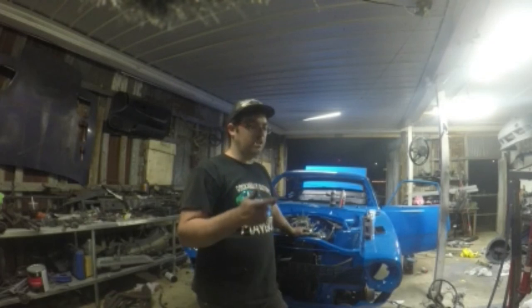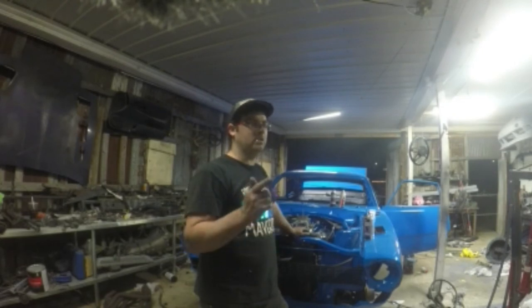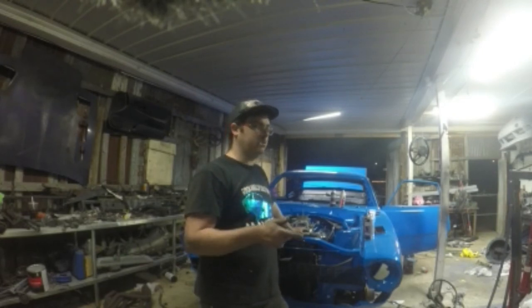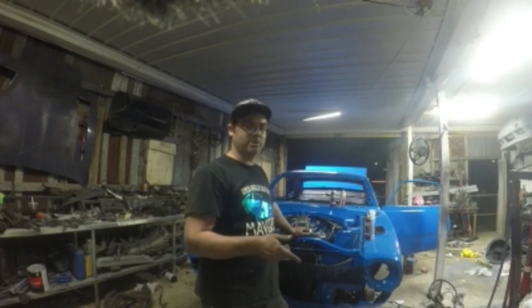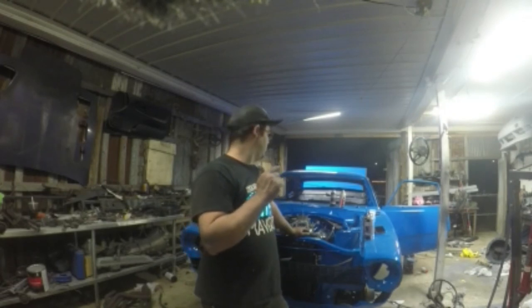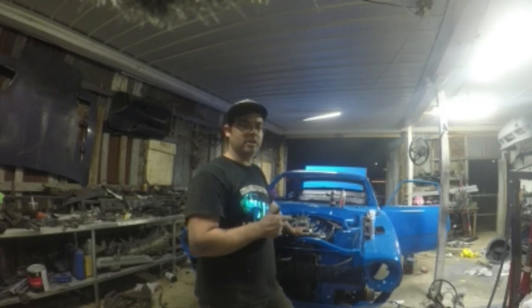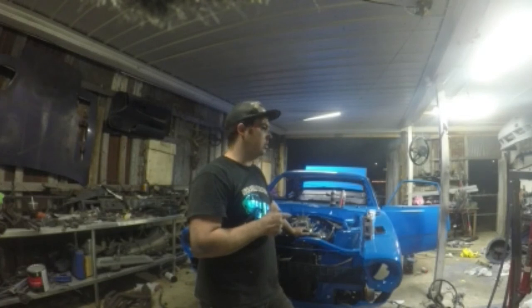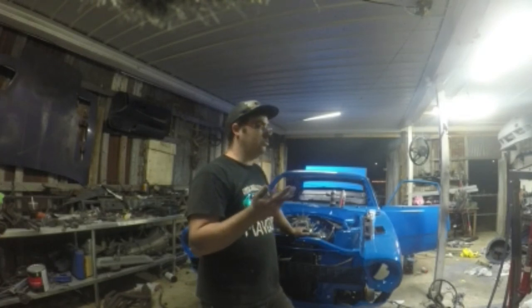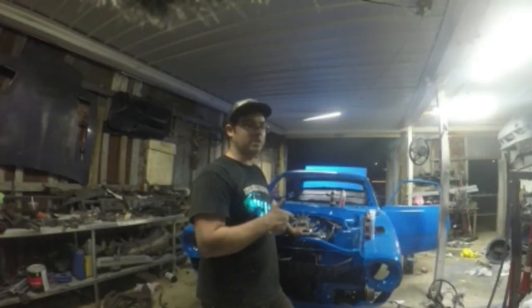So, the list of parts I need to still do. I still need to change out my tie rod and my inner tie rod boots. I need to do something about my lower ball joint boots. And I don't know about my upper ball joints, I think they are still good. So replace those and be good on the suspension. I can work on the brakes. I probably will have to weld that bracket to the spindle of the car, and also put some thread sealer on the bolt to hold that bracket on too. So just make sure that the thing does not come off. Then I can get the brakes done in the front.